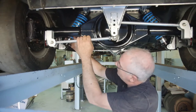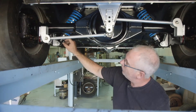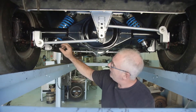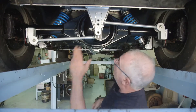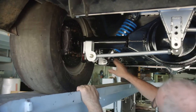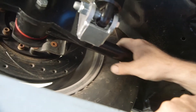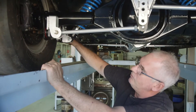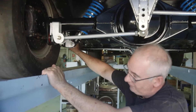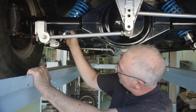We've got coilovers with 2 inches up and 2 inches down adjustment on the base setting. We've got all of the coilover settings: 1-4 for street, 4-8 for track and sporty handling, and then the next lock for drag racing to balance the torque. We can adjust the roll centre to get a nice neutral handling car, and we can adjust the Watts linkage to allow for frame error. We've got fixed arms so you just bolt them in the original location with no cutting and welding — and there's no adjustment on these arms for specific reasons. One of the problems with adjustable arms for a street car is the nuts all come loose. Anybody who's got some of these triangulated 4-links knows all about that — we don't want anything falling out of the car. It's got fully serviceable joints, bearings in all of the major locations, and the shocks are rebuildable.